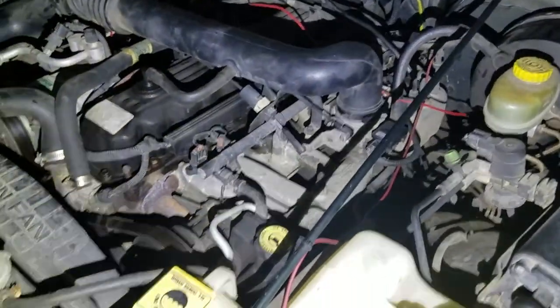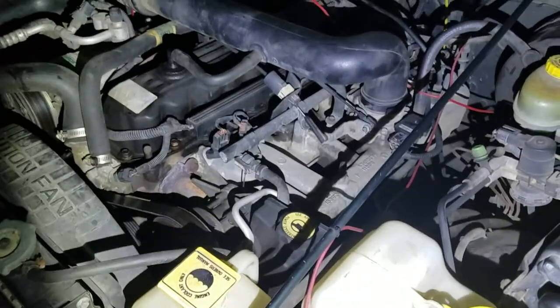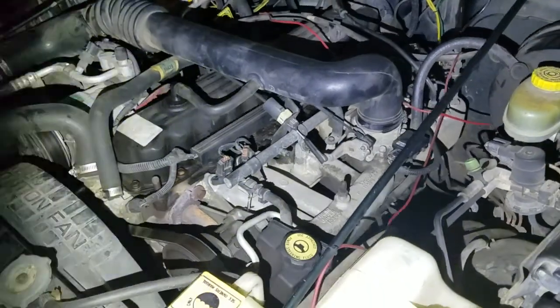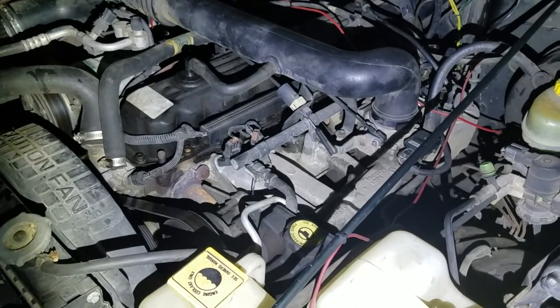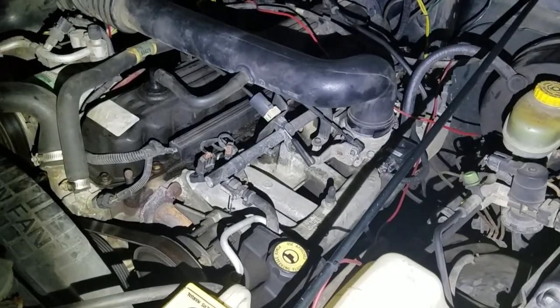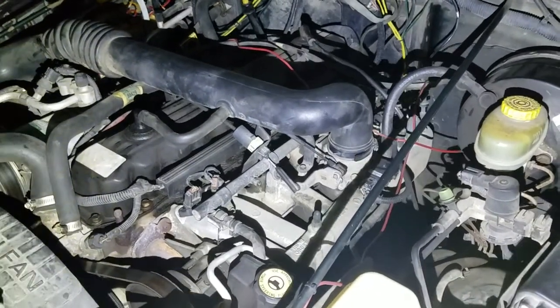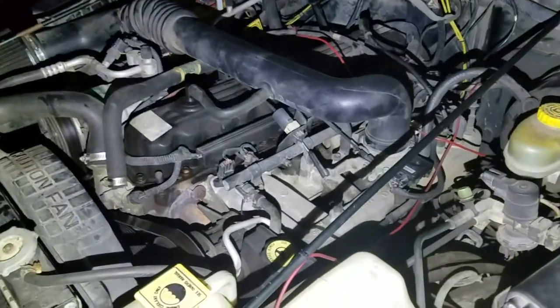Because this has been happening — and when it happened today — it will lug and sit at about 750 RPMs, then crash down to about 500 and surge. The other interesting thing it will do is when it's hot and this happens, it just dies — straight dies. No ands, ifs, or buts: it loses everything, gauges go to zero, everything goes dark.